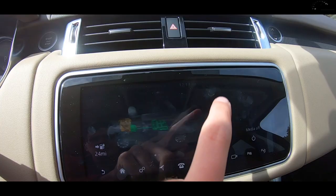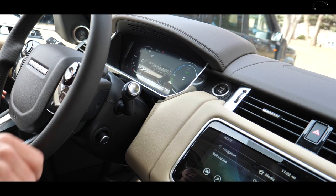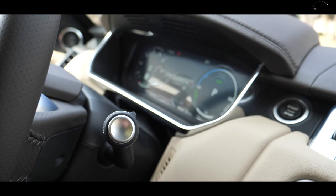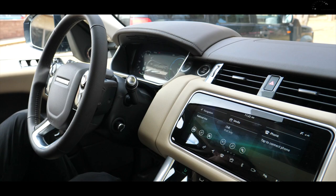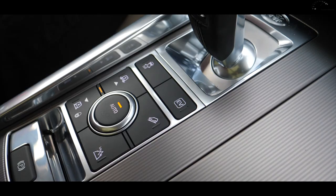How does the hybrid system work in the Range Rover plug-in? There's a large battery pack in the rear with enough power to propel the vehicle 19 miles per the EPA. In the front is a small gasoline engine that works as a standard hybrid when the battery dies. Starting the car, it begins in primarily EV mode, using the battery until depleted, at which point the gasoline engine fills the power gap. There's also an EV button that locks the vehicle in electric mode so the gas engine doesn't kick on at all — until the battery dies.